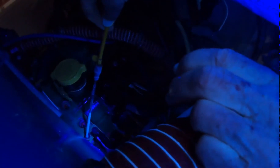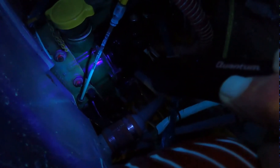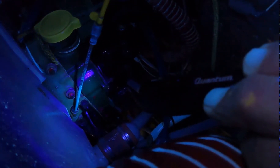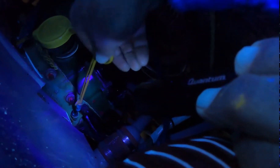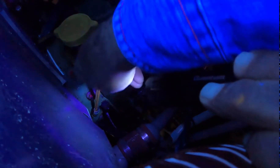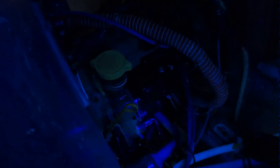Look on the back of this baffling here. I'm curious to see what it's going to look like when I pull out the dipstick. Whoa! Yeah — that's eight quarts of oil showing. She's green. That's another oil leak source you can get and not know it: you pull this dipstick out and shove it back in and it just wipes the oil off and lets it run down the side of the engine, and you think you've got a leak. But you just scraped your dipstick — and there's an O-ring right there with the dipstick. Well, I think we've got pictures. I think we know if we fix this leak, we can clean it up and check it again.